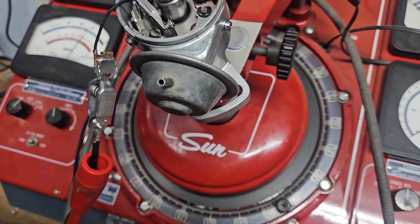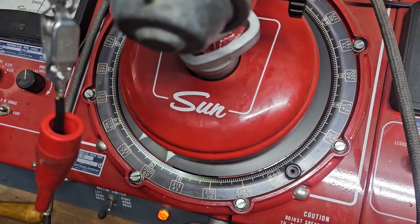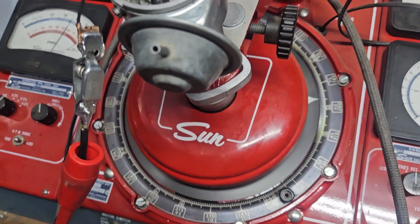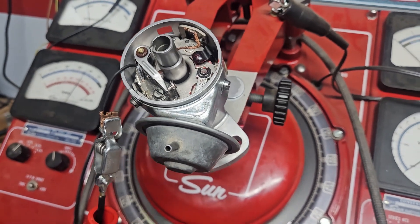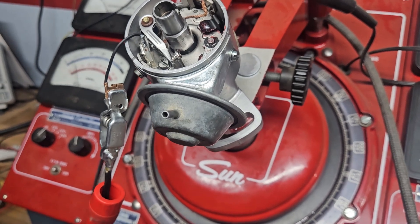Here's another example of why new parts are driving us nuts. That's called points bounce, when you see double arrows — about 1800 out here. And that's new points, just not made like the old points. You need new points because they wear out, but not like that.